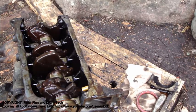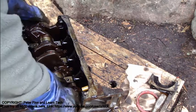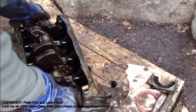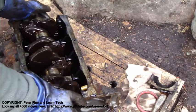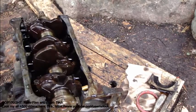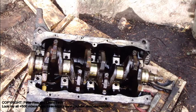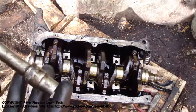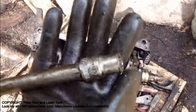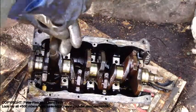And then I test — can I lift this crankshaft out? Okay, it moves out. But I need to take those connection rods out next. Then I open these connection rods, and for that job we need a 13 millimeter socket that fits in these parts.